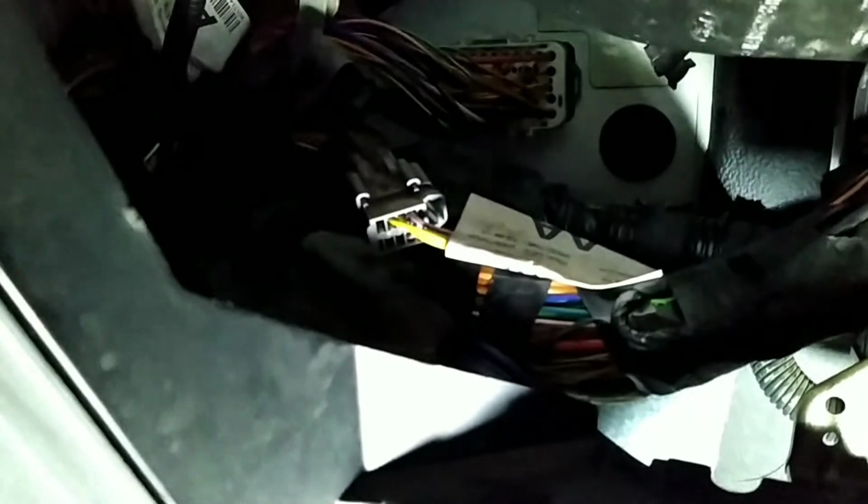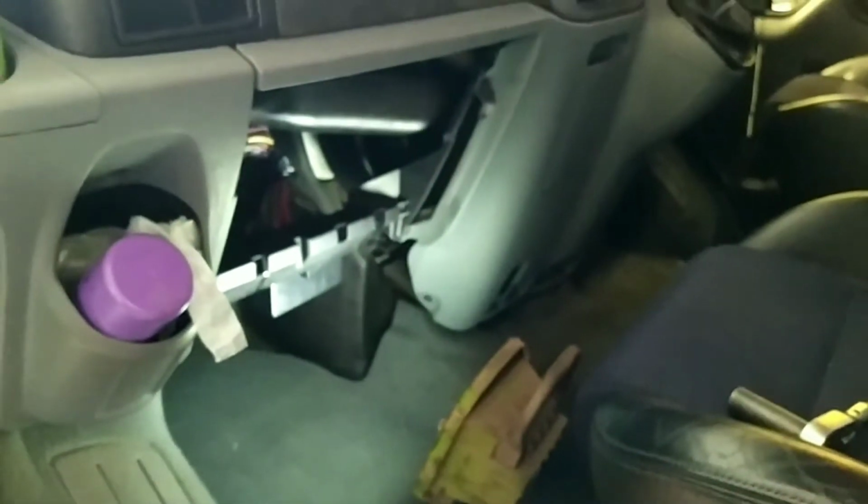With a Mark 7 dash conversion, should I say. My fuse box is tied up in the bottom, so it's up in there. There's three 13s up in the top there. Yours will probably be covered up by carpet, but mine's already been cut out, because I cut it out when I put it together. But that's the easiest way to get in, and there's plenty of access doing that. Don't bother trying to go underneath, because it won't work. You'll just end up wanting to throw your spanner through the windscreen.